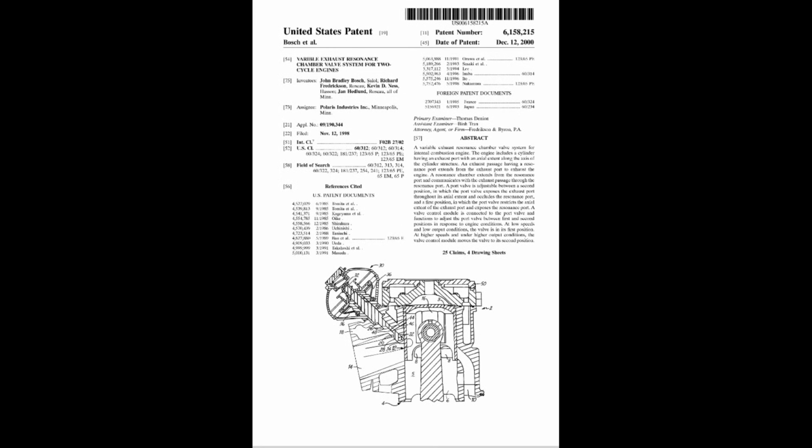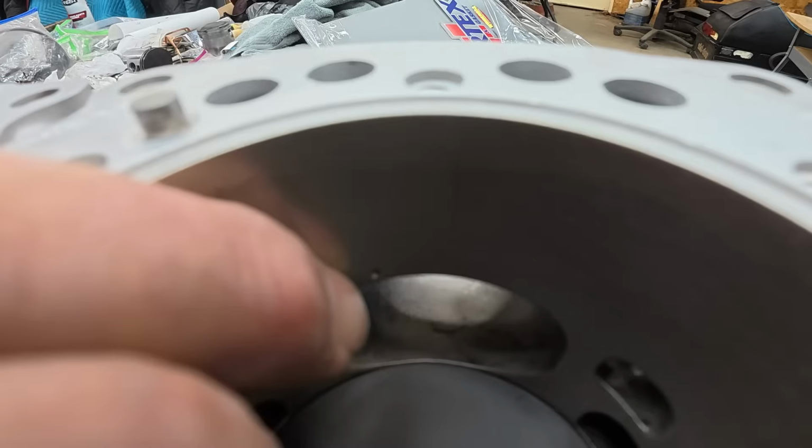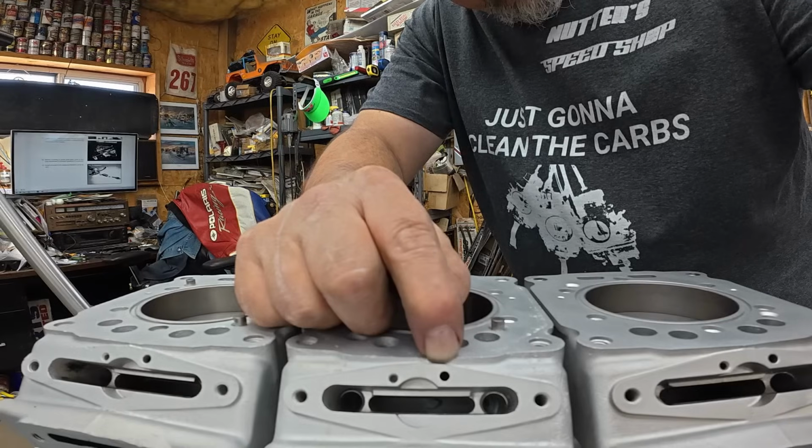Snowtech Magazine has a great article on the XCR800, and I'll put a link to it in the description. But in it is an illustration of the patent. So I'm showing you the cover page, and then Figure 4 shows how this really works. So there's a tiny hole in the cylinder, and that hole leads up to the underside, the engine side of that rubber diaphragm. And, well, we'll take it from there on the video.